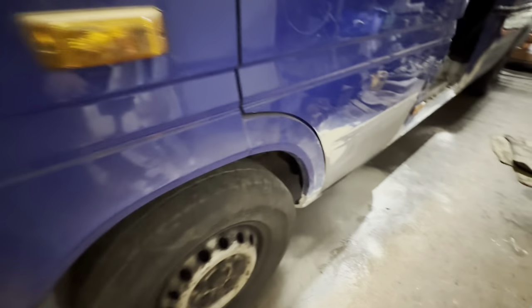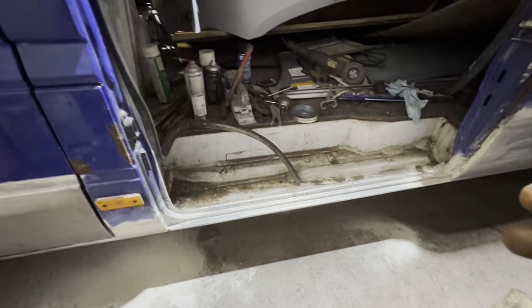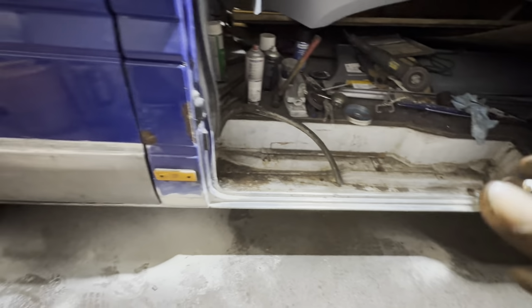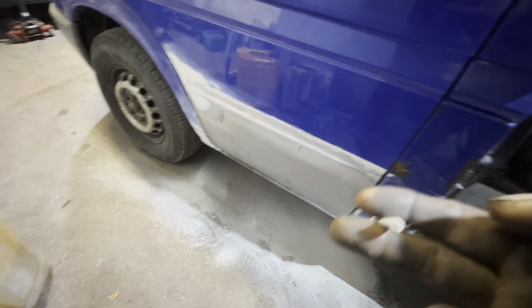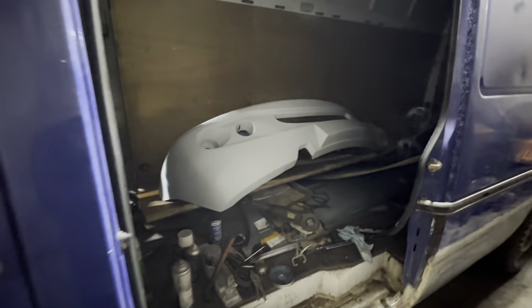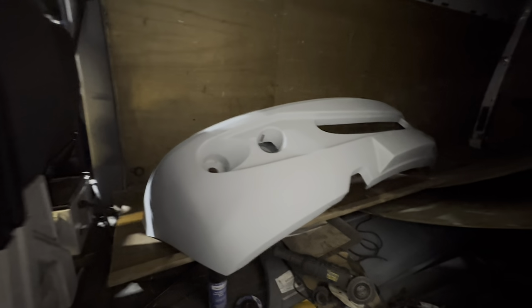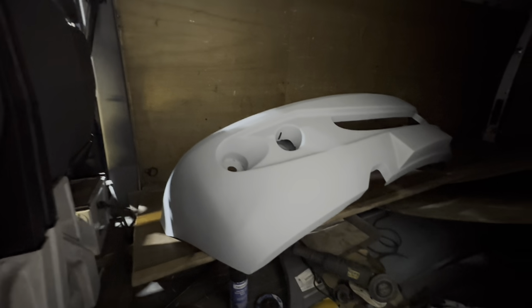But obviously it was a bit rusty, because it had had a bit of a dinger years ago. So it's had all of that bit to repair. We put a new sill in it there, obviously door, sliding door sill. New door bottom in and outer, and it's had a new front sill. We have repaired the bumper that's like gold dust and you can't get. We actually made it out of aluminium, that entire corner. So it's got very minimal flexible filler because it's a big plastic thing, and if you touch it on anything, it just breaks. But that's made it much stronger, so that's got to go back on. So you'll probably see that this week, some of them 510 Starline things.